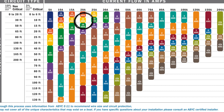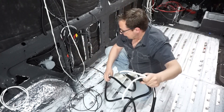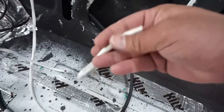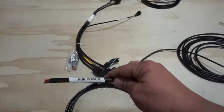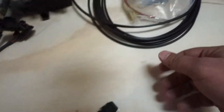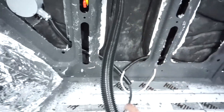So I've decided to stick with 12-gauge and keep the wire to 10 feet or under, which is acceptable for a critical asset like this. We've taken our 12-gauge cable at 10 feet, pre-wrapped it in looming, and run it along the bottom side all the way up to the front where our batteries are going. Then we label the wire on the wiring harness 'fur power' to match. Everything is now labeled: fur Wi-Fi, fur pump, fur start — all the wires are loomed, rolled up clean, and labeled, ready to be plugged into the wiring harness — literally plug and play once we have walls inside that van.